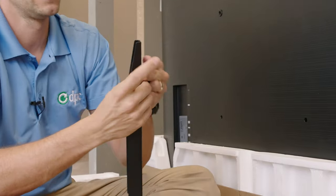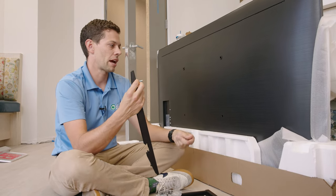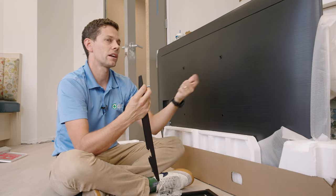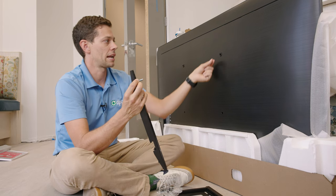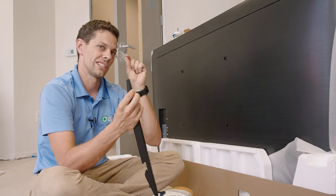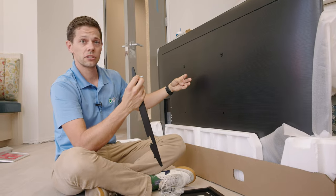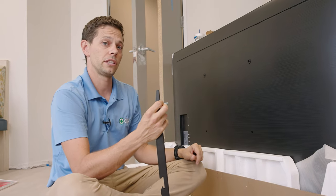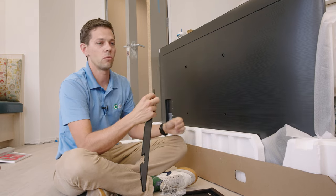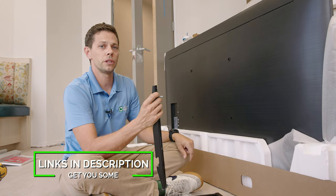We'll use one of these little black spacers with a very specific purpose — putting it between the bracket and the TV so the bracket stands off the TV a little bit. Because newer TVs have a slight curve, it helps deal with that. It also helps if the TV ends up too close to the wall, giving just enough slack for cables in the back. If you have an electrical outlet in that void, you won't have the depth needed for cables. You may need a recessed clock plug from Lowe's or Home Depot — we'll link one in the description.